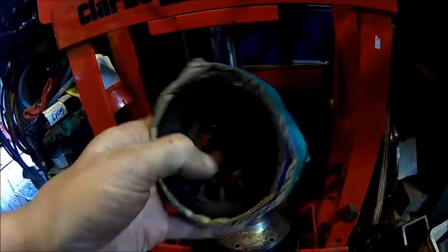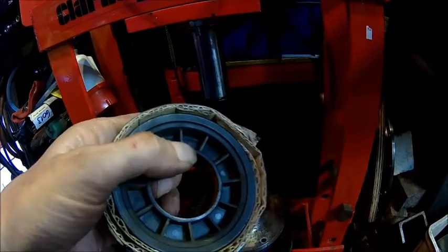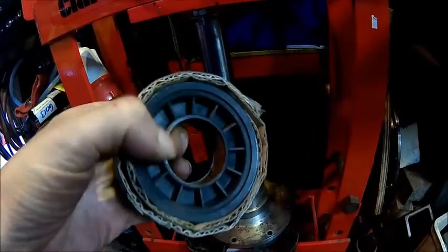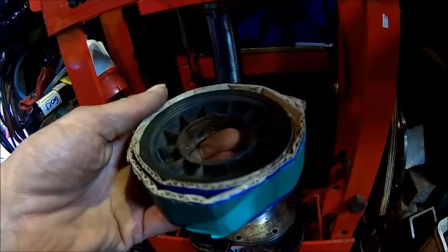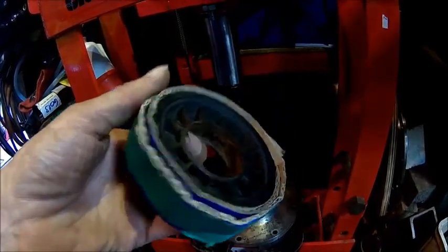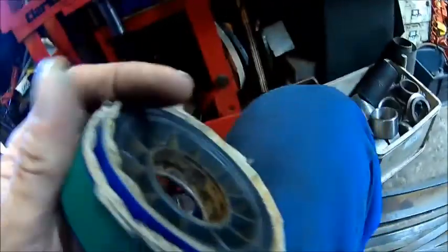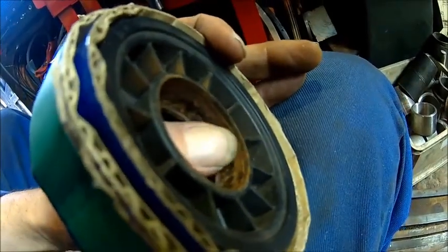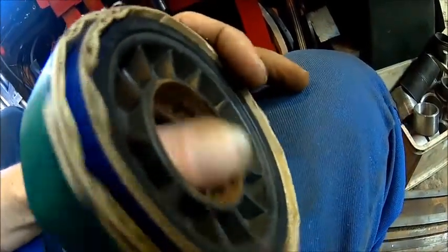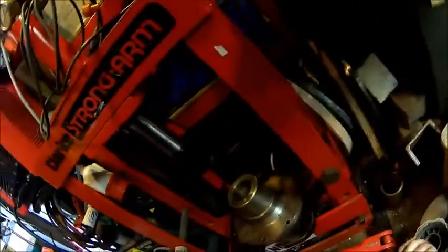Yeah, we still left a little bit of a hump there, so if we deburr the outer diameter, we can just press it in and perhaps put a bit of super glue on it, and it's not gonna move. It's hard to see, but there's still material left, which is smaller in diameter. It was just rusted in. Let's see how the bearing looks.